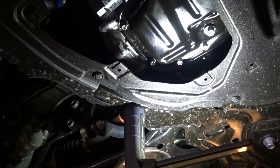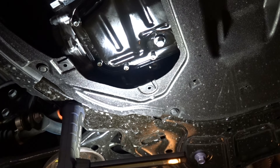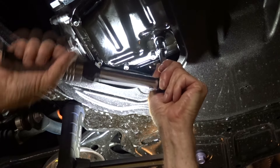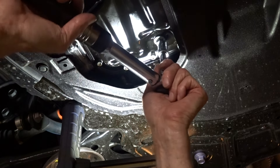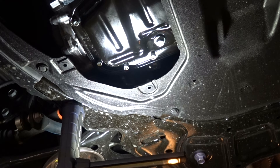So now you just have to torque this nut and we're good to go. According to the internet there are about six different torques for this. However, the most official one I could find was 37 newton meters or 29 foot-pounds of torque, which is probably plenty. I've got my little wrench here, which goes up to about 25 foot-pounds, and I just give it a couple more degrees, and I think that should be good. Last thing I'm going to do is just spray a little brake clean, put that cover back on, and then we'll go up top and refill the oil.